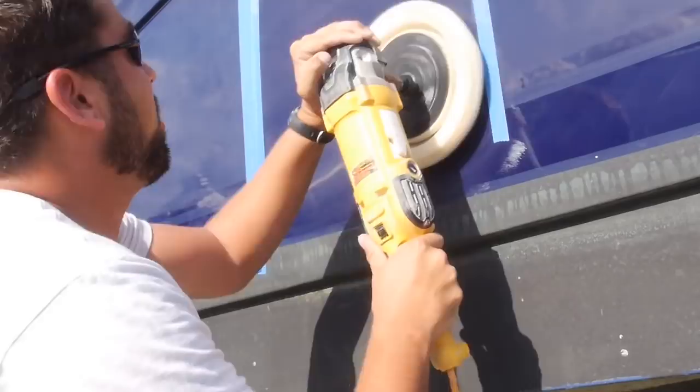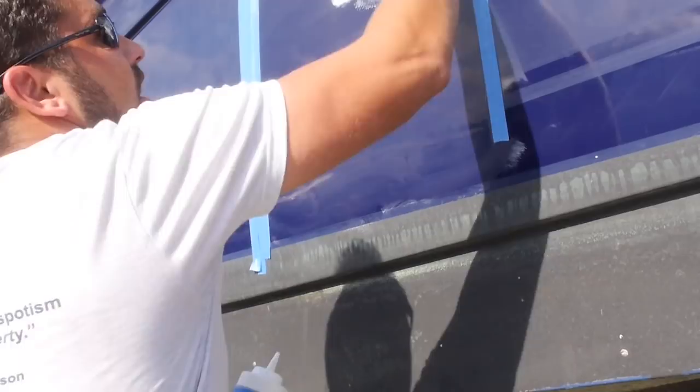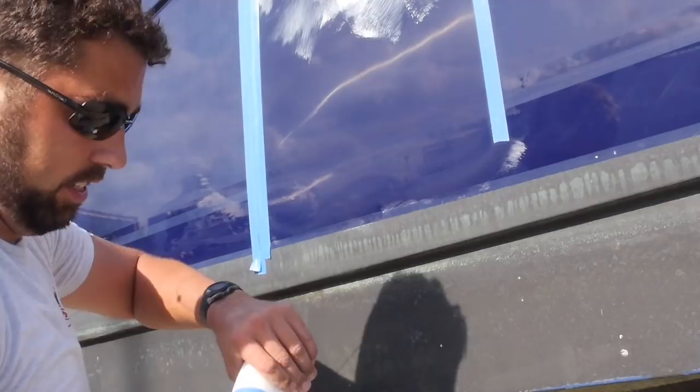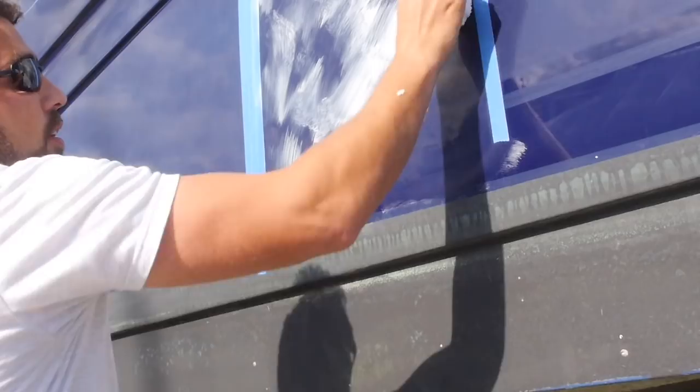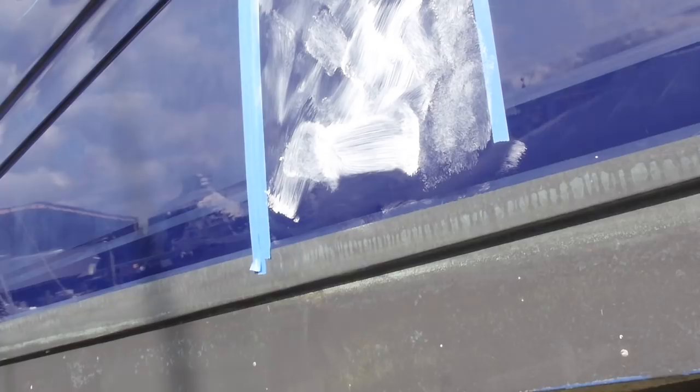I talk too much, and our compound already got a little baked. These first few passes, we are effectively grinding off oxidation, bad gel coat, just all the hard water and crap that has been cooked on this hull. So we're using a ton of compound — way more than you'll see me using at later stages. But right now we are in the cutting stage.